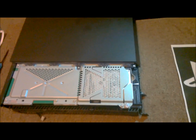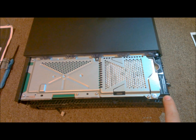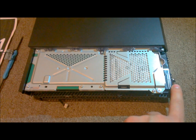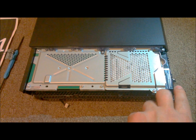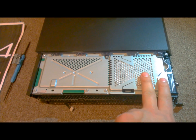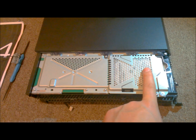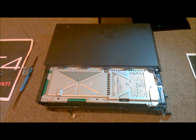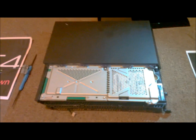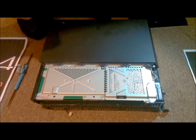So what it comes down to is, I think I was wrong in the beginning — some of those screws in the back were warranty screws and some of them weren't. The ones that weren't, on this side of the console, you just take one or two of them out, pop this back, and you can access your hard drive for easy maintenance or upgrading. So you don't have to void your warranty to replace your hard drive on the PlayStation 4.